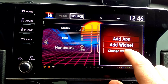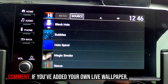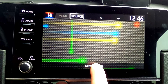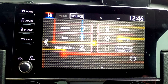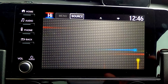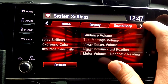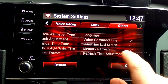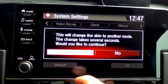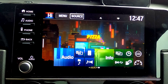They also give you live wallpapers to play with, which is really cool. I was wondering if you could add a GIF — I haven't found a way, but it doesn't mean it doesn't exist. You can select a live wallpaper and it'll give you a preview so you can see what it looks like. So whether you want a static image or a live wallpaper, you have options. To switch back to the alternate skin, go to Settings, System, scroll to the 'Other' tab, select 'Change Skins,' confirm with Yes, and it'll flip back in a couple of seconds. Just be aware that switching skins will reset your background image.